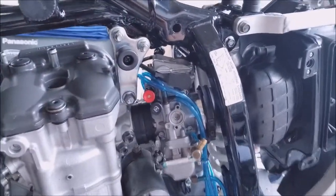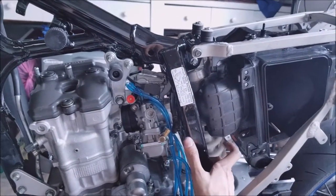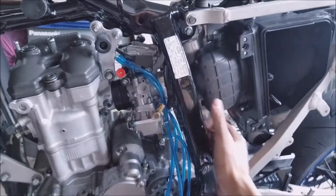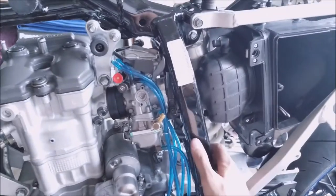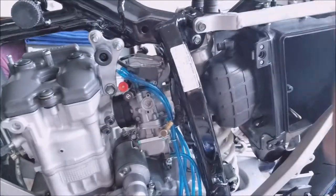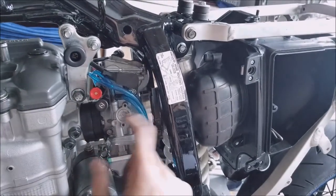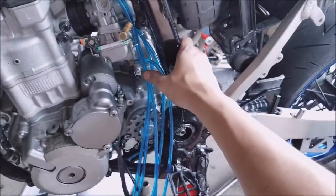So I just want to give you guys a look at the progress right now. The carb is installed in here — it's pretty hard to sandwich the carb between the airbox and engine block. Because I can still manipulate the subframe and remove it and wiggle it around, it made it easier. But if everything else is attached, I've heard it's pretty hard to wrestle it in there. Make sure the boots are covering all the necessary ports because you don't want any air leaks — the bike's gonna run bad.